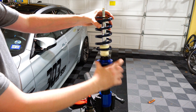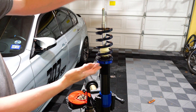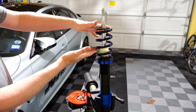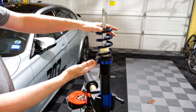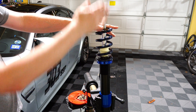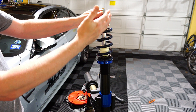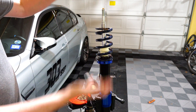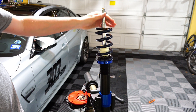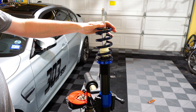That's how you adjust the height: the car pushes down from the top with the same amount of force applied on the spring, so it will compress a little bit and the damper will basically move down. This shaft provides resistance to the spring so it dampens the movement and the car doesn't just bounce on the spring.